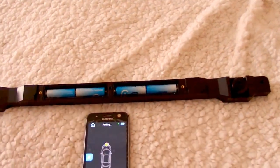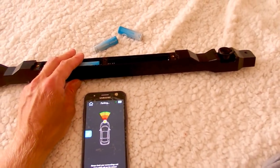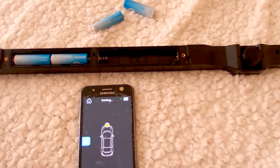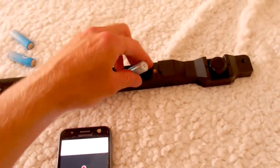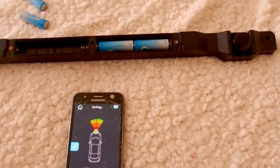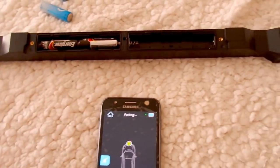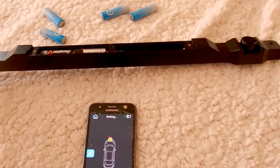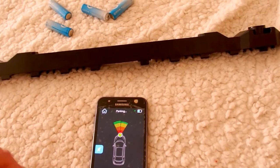Does each sensor have independent batteries? Let's try — let's remove one set of batteries. And what happens? It looks like both sensors are still working. That's odd, and both are also clicking. So it appears to be a backup system — any pair of batteries can run the entire machine. Let's put the batteries into the other space — and it works again. So it looks like a backup. Now if I put partially discharged batteries in it, about 1.2 volts — does it work? It does, and it shows the battery about halfway full. So it definitely seems to work.